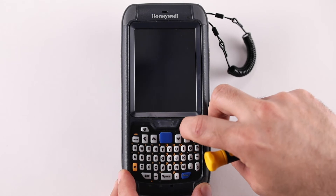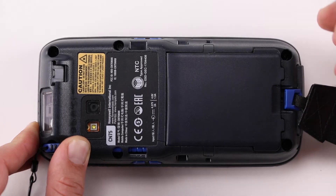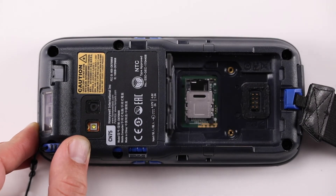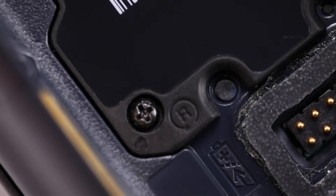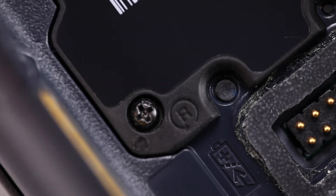Press the Power button on the device, then select Hibernate. Insert the Micro SD Card in the device. Cold-boot the device by pressing the Reset button found in the battery compartment.